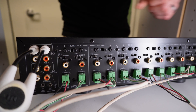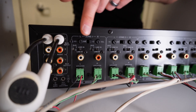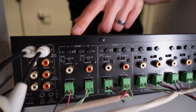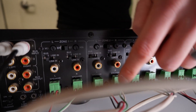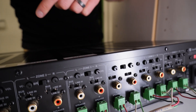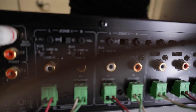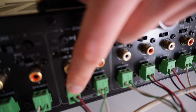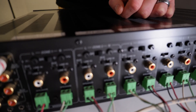This is the back of the amplifier. You'll see these are the two line-in inputs from the Chromecast. Each output is one speaker but two channels, so there are six of them — that's how they made the zones. There's a positive and negative for left and right channels, but we only have two power amps. Each power amp has essentially a left and a right output — the black and red, and the green and white — those are your left and right channel outputs.